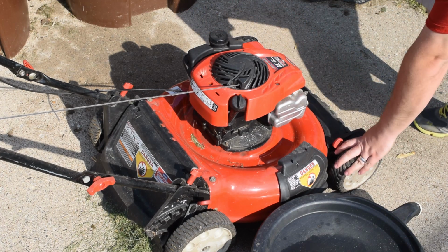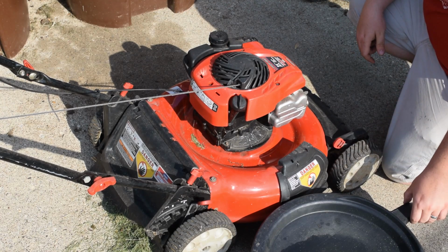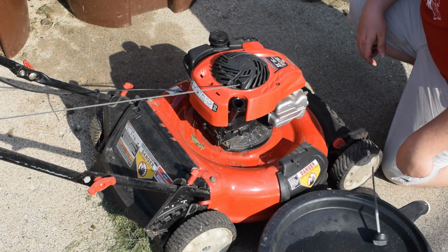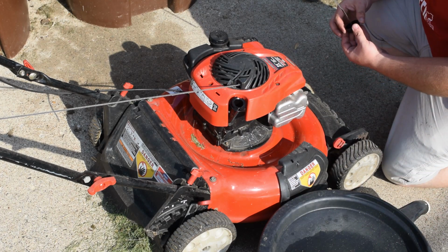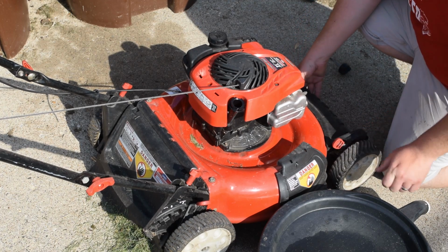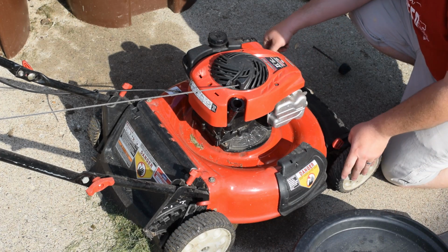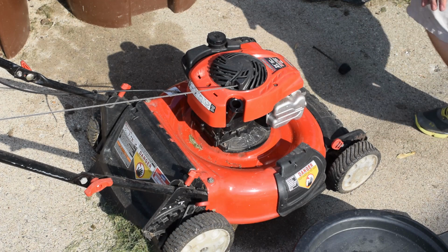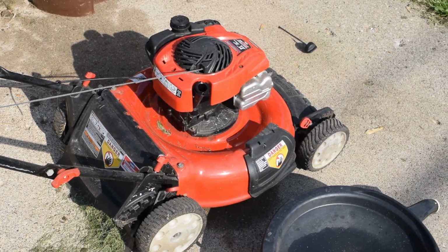Then the next step is to make sure your gas cap is on extremely tight, and then pull off your dipstick and drop it. You always make sure you drop it. That's a requirement. And then, just like before, grab the entire lawnmower and tilt it. Actually, I think I need to move the lawnmower this way, or yeah, let's do this.